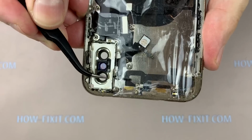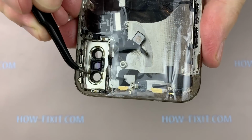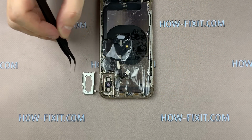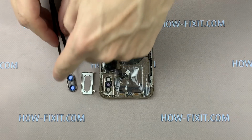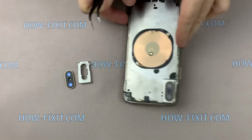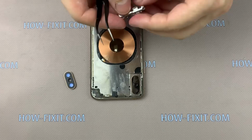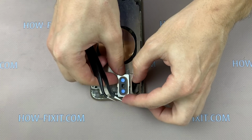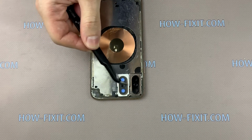The camera lens cover is welded to the case of the iPhone XS. To install new glass, you need to remove the camera cover. The correct decision in this case would be to buy a new metal camera holder and camera lens cover. A link to these parts can be found in the description under the video. Why do you need a new metal camera holder and camera cover? Because when the camera cover is removed, deformation of the metal surface occurs, and when you glue the camera cover back, it will not hold well.